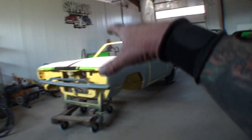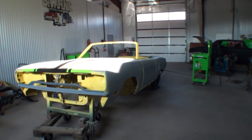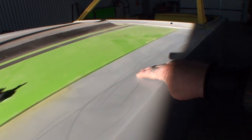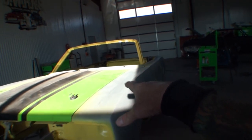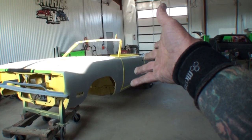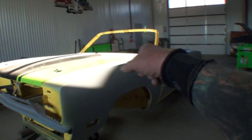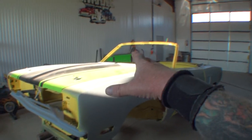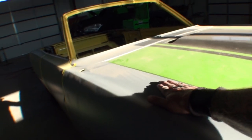When you come to a situation with a car like this, you want the car to be extremely nice. You don't have an attitude that says 'as long as it looks half-ass, I don't give a shit.' Here's a good example — if we look at the top of the fender here, you can see where I went over it with a pencil. That means the top of this fender is in need of extreme body work still. When I did the body work to the bolt-on parts, I didn't do them on the car, I did them on stands. When you do body work like that, you have to go back over it.